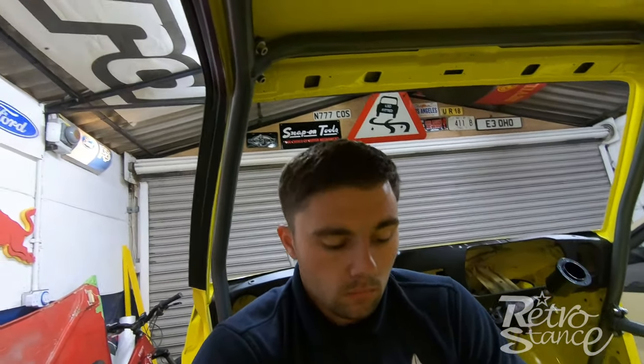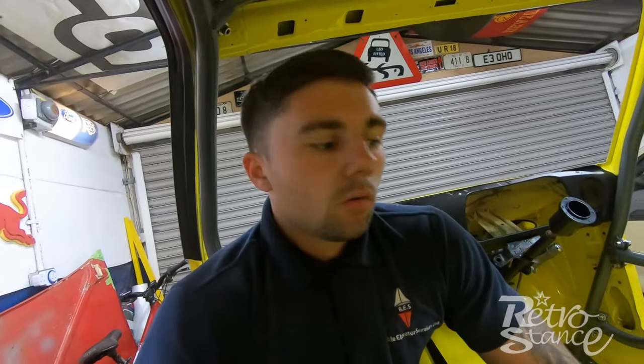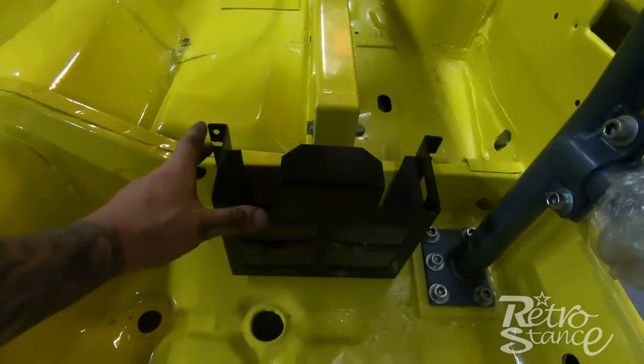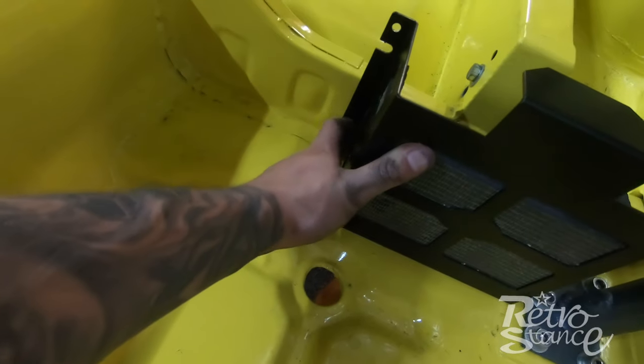After about half an hour of messing around I've decided where I want to put it — behind the passenger rear seat. I know it's meant to be better for weight distribution with a driver in there, and I don't really want to run a big cable all the way to the boot. It also looks a bit ugly in the boot because I've got all the carbon and fuel lines going on. I'm going to mount it with rivnuts — one down here and one higher up — and if that's not secure enough I'll add a couple in the floor and space it up.